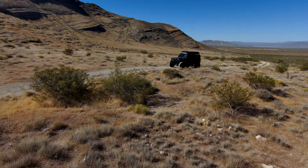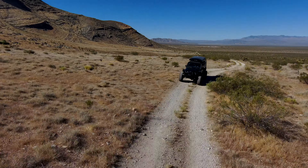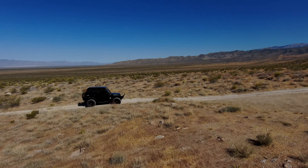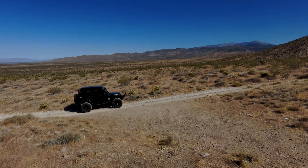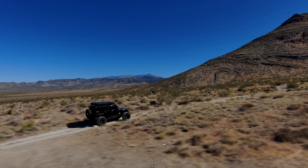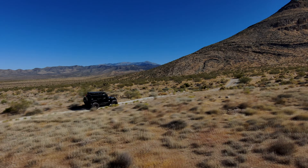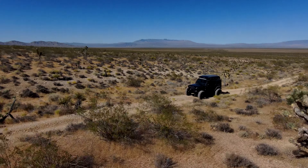A lot of you want to buy LT4 kits. Until now we haven't offered one, but over the last few builds we've been refining the LT4 install in the JK and we hope to offer it in the JL and the JT. We've got some new brackets, new air intake components. The LT4 is larger than the LT1 — I'd say not quite as big as the L86 just because of how it lays out. We're using our easy mount like everything else GM.